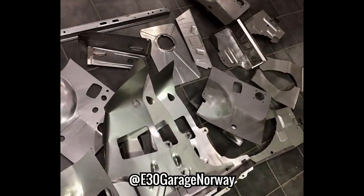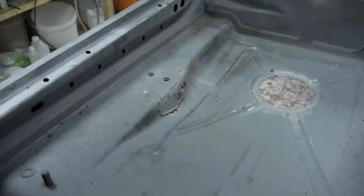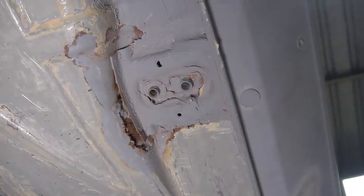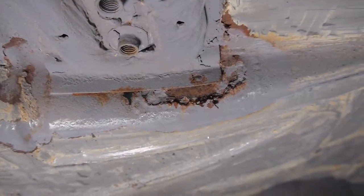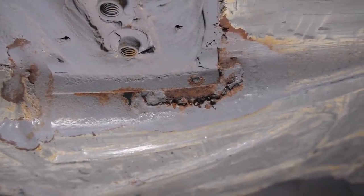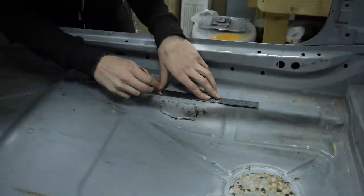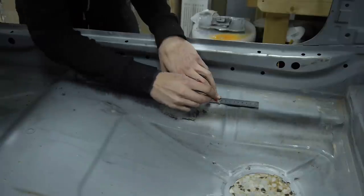All of that to come starting next episode. In this episode I'm going to focus on this awkwardly placed lap weld. Underneath it is the bracket for the front seat to mount to. That bracket was also rusting, so my plan was to remove it and either clean it up or replace it for a new one. Firstly I needed to remove this lap weld without damaging the bracket beneath it.